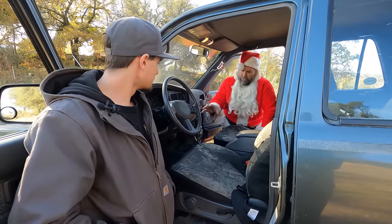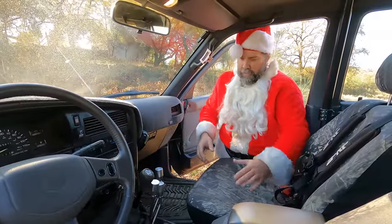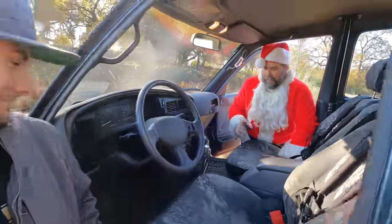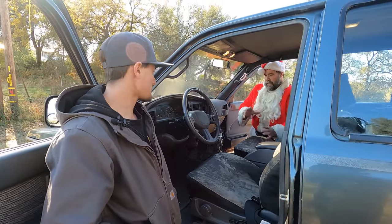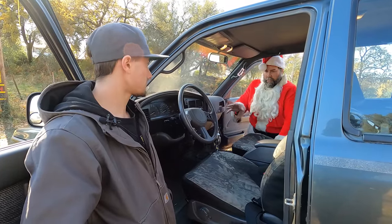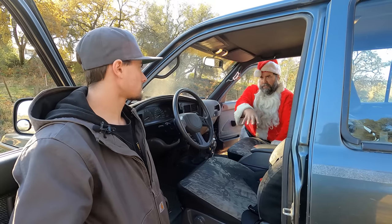Even when you're drunk it's easy. So this is the Northwest Fab doubler — they just give you an empty case. That's the one that was sitting on the floor with the dicks drawn on it last year. Then you locate an extra Toyota chain-driven transfer case, remove the planetaries out of it, put it in the crawl box, and put it all together.